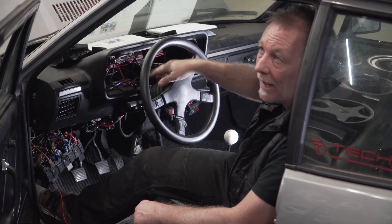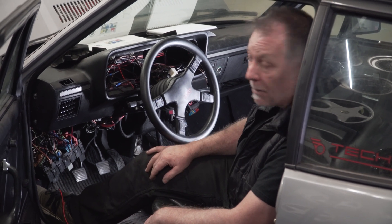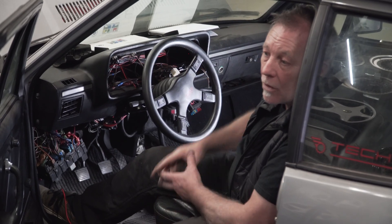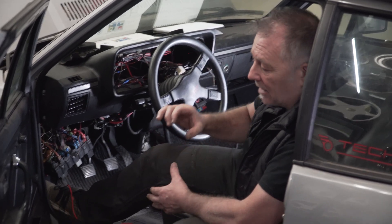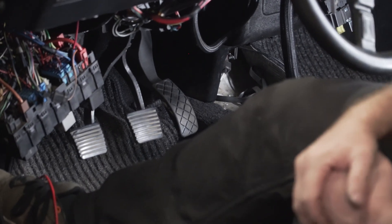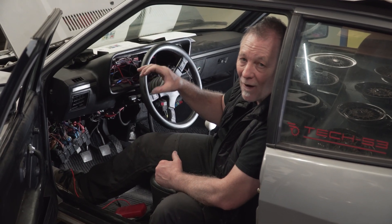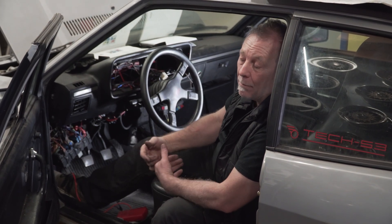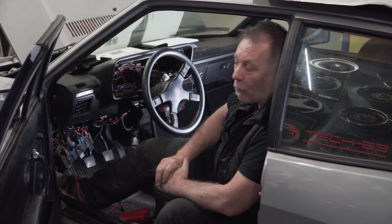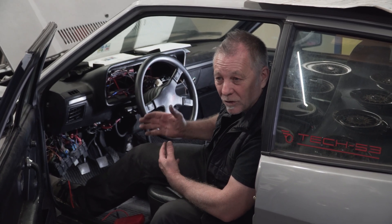It's pretty much all just a question of routing them into the dash and bringing a switched 12 volt and a live 12 volt into the wiring. The Mark 4 gas pedal is the one I used — the reason is the connector from the Mark 7 is a lot larger on the pedal cluster and it won't go through the OEM-size firewall hole, so we came back and used the six-wire connector on the Mark 4 gas pedal, which works fine.